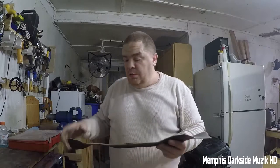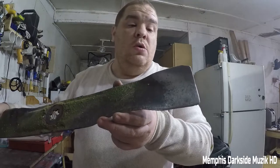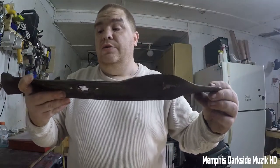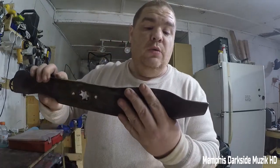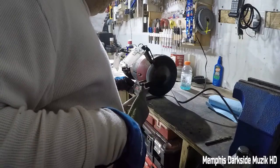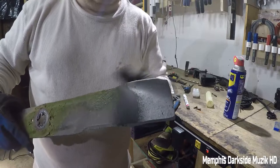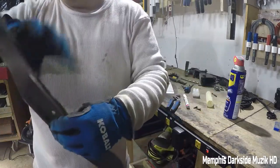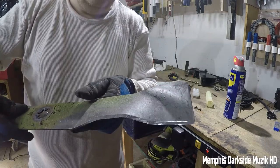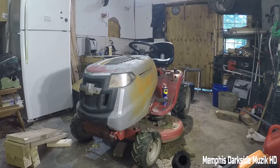I've been doing other stuff to this riding lawnmower. The blades on this thing are very, very dull — as you can probably tell. The blades don't look bent to me, but I want to say these blades are damaged. We got to go ahead and get the second blade off — so one blade down, one more to go. Actually, right now I'm going to go ahead and blow all this grass out from underneath the deck.